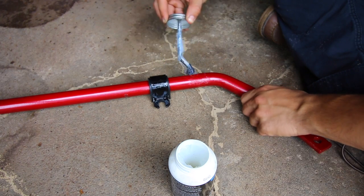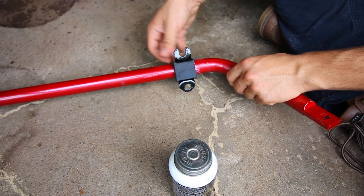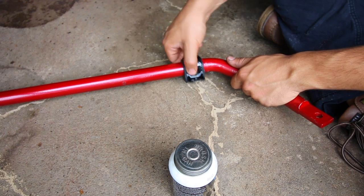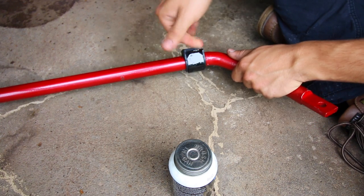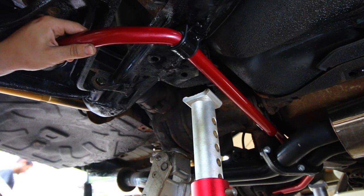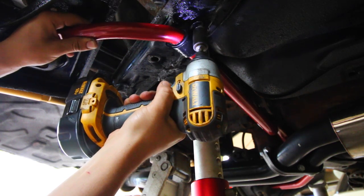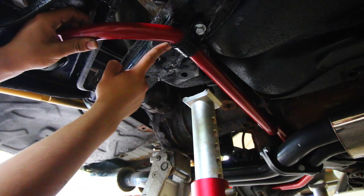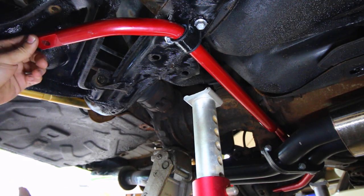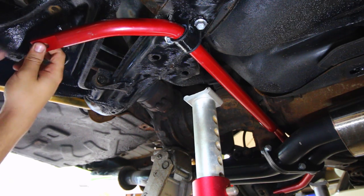The bushing is going to sit right about here on the sway bar, so I'm going to apply a little silicone in that area, then grab the bushing, slide it over top, and work in the silicone. This way, when we go over a bump and the sway bar wants to move up and down, it can spin freely from the rubber bushing. Do the exact same thing for the other one. Underneath the car, once you have the sway bar lined up in the bracket, grab your bolt, slide it underneath, and thread it in place. There's one bolt on each side. At this point we just need to install the sway bar end links, since the sway bar is mounted but not yet connected to the control arms.